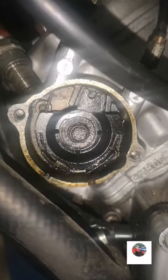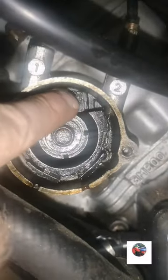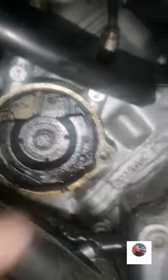With the hole behind lining up, once you turn your key, the power valve's open. So if you ever want to pin your power valve, turn your key like that, knock it off, disconnect this plug and this wire off your servo motor, then put something through there into the hole behind to lock this, and it locks the power valve.